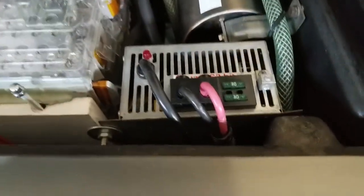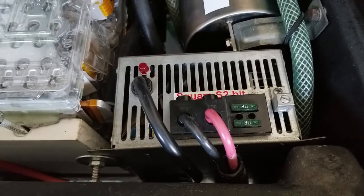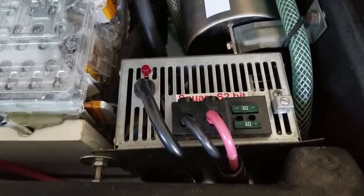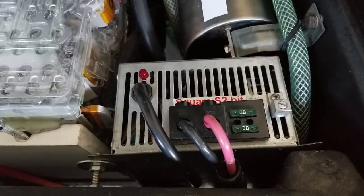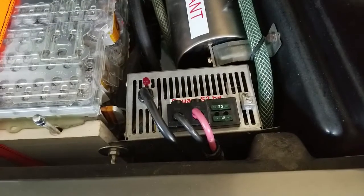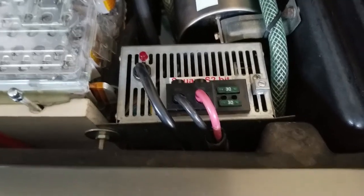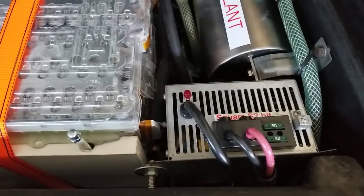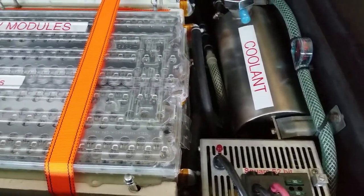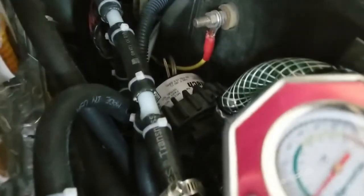This is what we call the DC-to-DC converter. What that does is charge the auxiliary 12-volt battery that's in its original place behind the passenger seat, keeping it charged off the power of the traction pack — the big pack — so that it will run the accessories. In heavy duty operations, the batteries and the controller can actually get hot, and they are cooled by pumping antifreeze through the system.